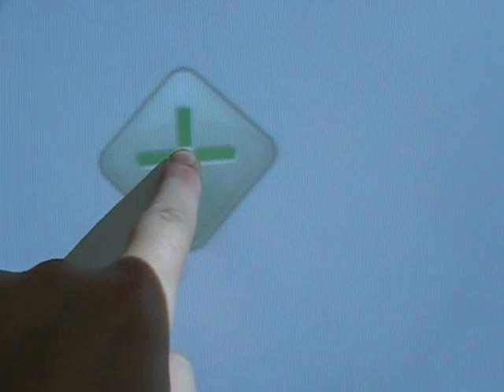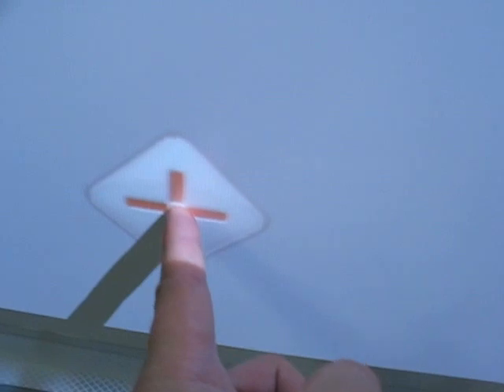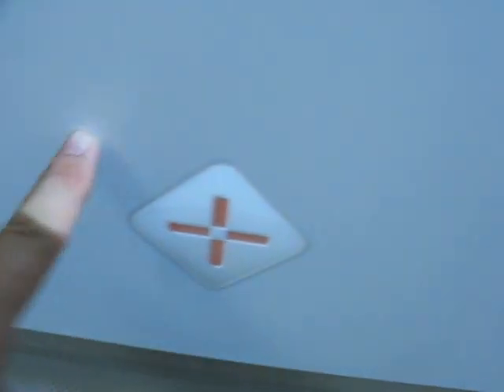I'll just try and do orientation. Now if I just put my finger right on it, you see it does light up green, so it did find my finger. So now we'll go down to the bottom left corner. I'll put my finger on it, and you'll see that it stays red. And if I move my finger around, it still stays red. So there's a large dead area.